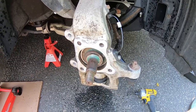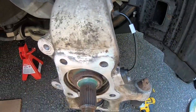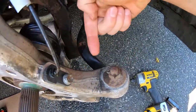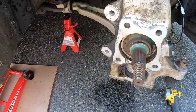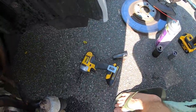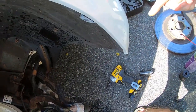With the right tools, everything comes out fairly easily despite the fact that everything was seized. I had to apply a nutcracker on this hub for quite a while. One important tip: make sure you rotate your steering wheel from time to time to get access and clearance to the bolts. When the wheel is facing straight you will not be able to access all the nuts, so I turned it one way, popped two off, then turned the wheel the other way and popped the other two off. I used a big impact and then a small one to finish. If you don't have one, you can use a breaker bar, but it's going to be a pain.